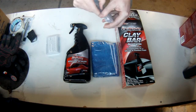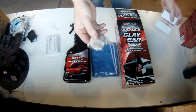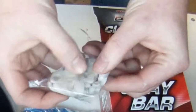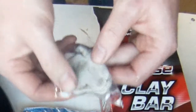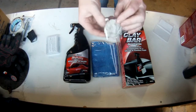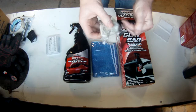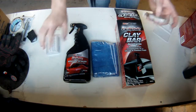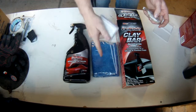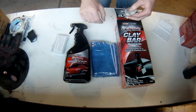Here's a bar that I've already used fairly extensively, and you can see just the amount of dirt and muck that it picks up. In our case, in there would be a little bit of colour overspray from when I painted the front of the car in black, but also there's a lot of undercoat and primer that will be in that bit that we're getting off, and you can see that in this video. So what you get is clay bar, your spray, and your special cloth to be able to wipe it all off when you're done.